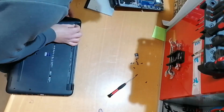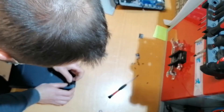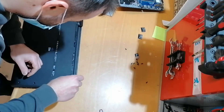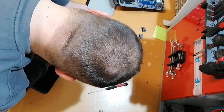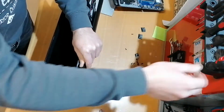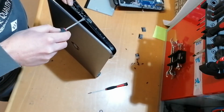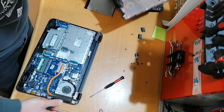I opened up the HP laptop. You should take care of the two screws hidden under the rubber pads next to the battery - it took me some time to find them. This laptop has a VGA connector which comes out of the casing more than any other connector, and it's quite tricky to remove the case around it, so be careful.